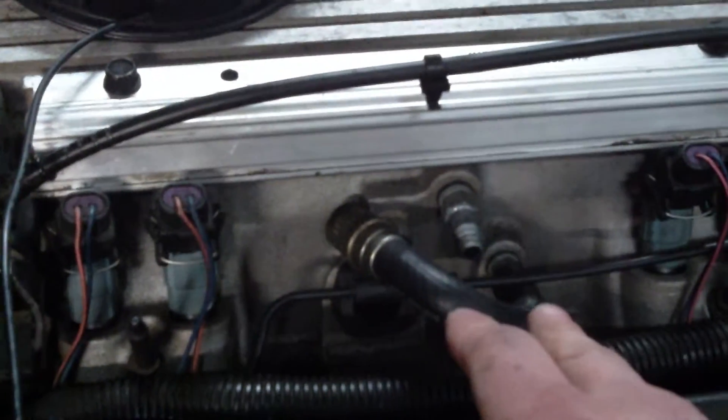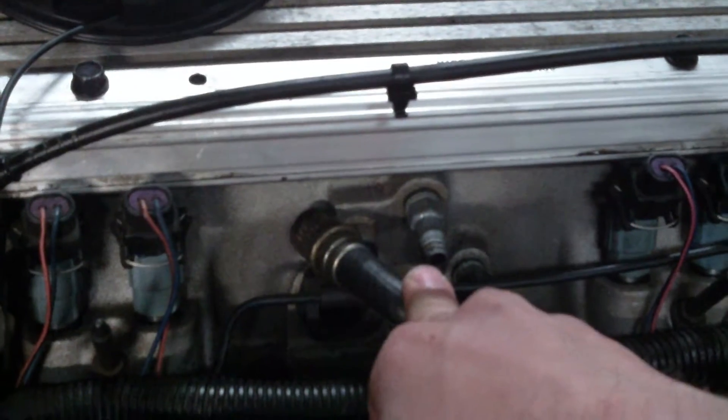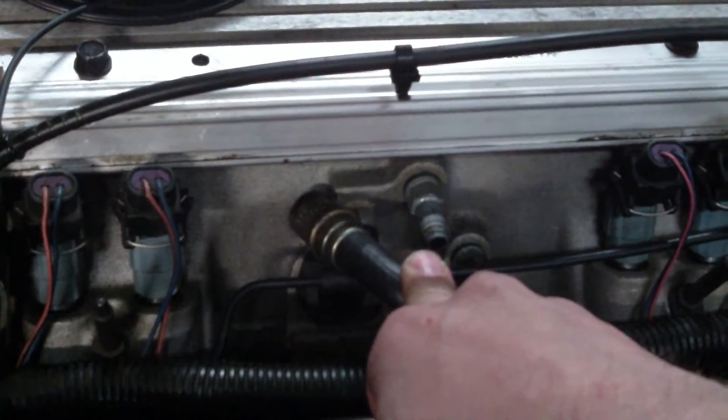Pretty simple, and they're cheap to replace. If you have excessive oil leaks and you're blowing gaskets left and right after you've replaced them — they are old, they're going to leak — but if you replace them and they're still leaking, you need to check to make sure you've got good positive crankcase ventilation and the system's working.